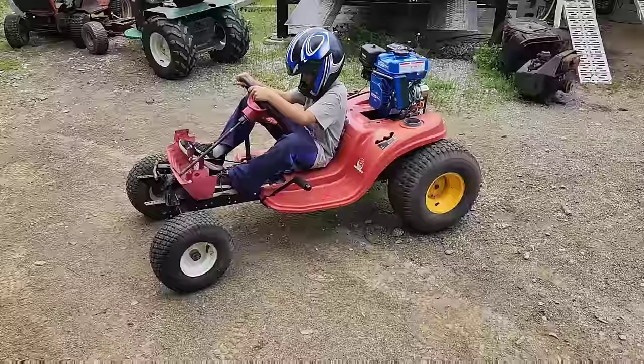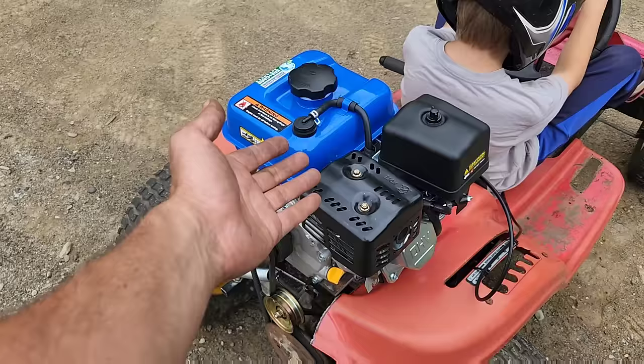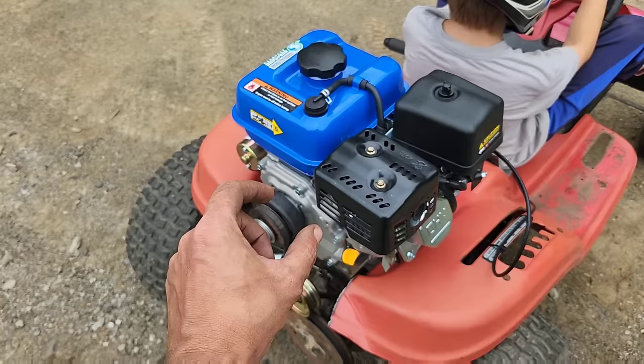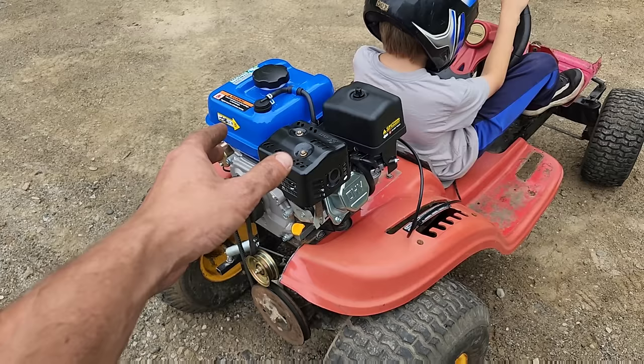All right, learning experience I want to pass on: that clutch does not seem to actually engage until it's almost at about 2,000 RPM or so. With this thing currently maxing out at 3,600 RPM, there's a very small thousand-RPM window that seems to be going on. So we definitely need a carb upgrade, maybe some exhaust and some other stuff - get the RPMs up more into like 4,000 grand and this thing would definitely go pretty good.